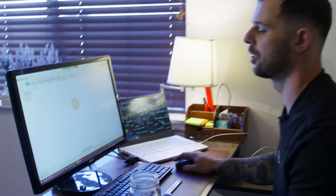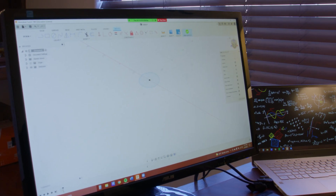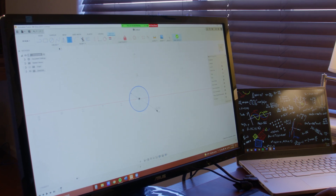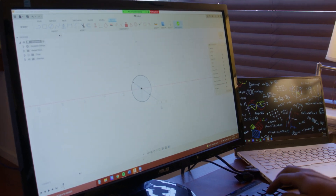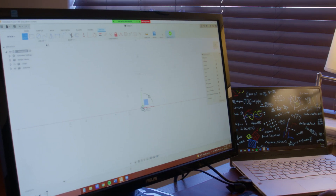We took our measurements from the car — the two most important being that distance from the center line of that roll cage mount back to that heim, and the width in which we can make that web bracket come back in. We're going to transfer those to the CAD now. Let's start with the sketch. The main point is that we want that tube — we're going to call that three-quarter of an inch — and then we're going to draw our line off of a center line.